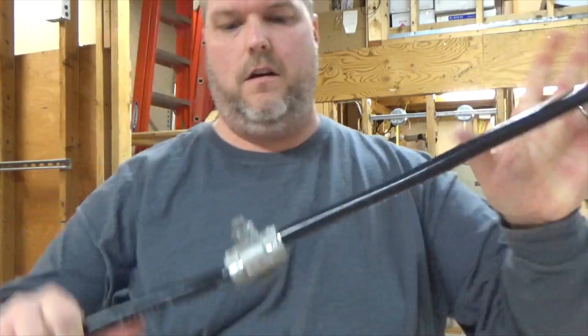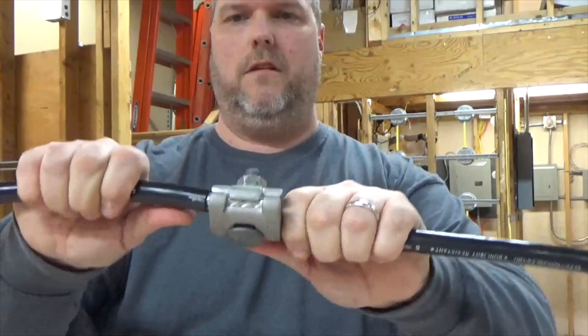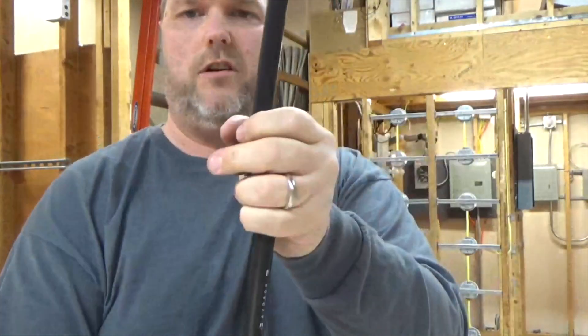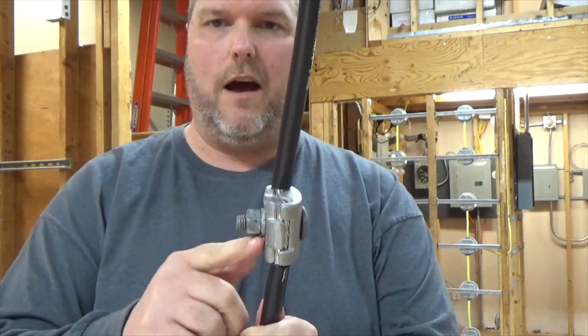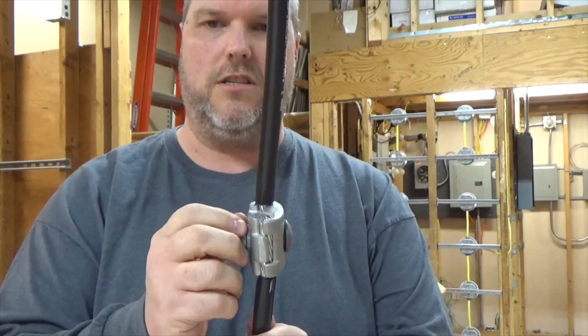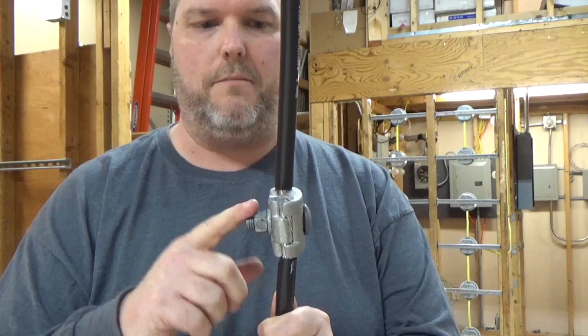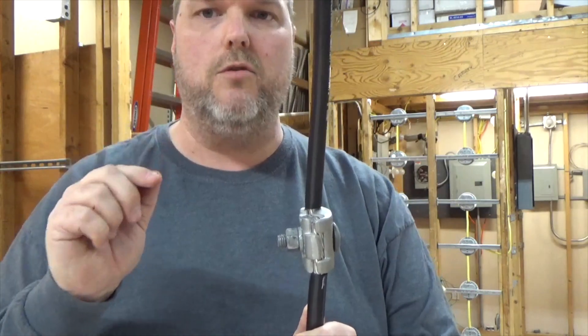Keep in mind, most of the time you're doing that on a ladder. So now I've got my wire in line. I could be working in a junction box or something of that nature. Instead of wrapping over just the nut, I'm going to wrap the whole thing with rubber tape. Because this is 4-aught insulation, the insulation is a little bit thicker, so I'm going to use probably about 18 inches worth of rubber tape.